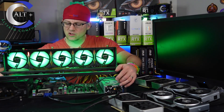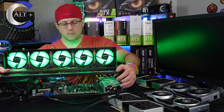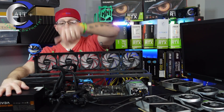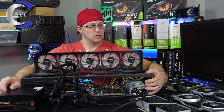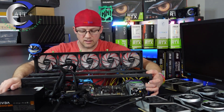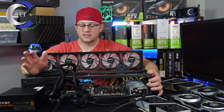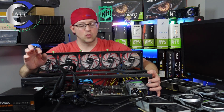We're going to do the power supply first — just set another power supply beside it, plug in the main CPU and 24-pin, and see if we get post that way. Now we've got an EVGA 600 bronze set on the desk; I plugged in the 24-pin and the two 4-pin CPU eight-pin power. The CPU fan kicked on right away. We're going to let it sit for a while, and we can also remove the CMOS battery, unhook the power supply, and reset the settings to make sure it's not just a boot issue.